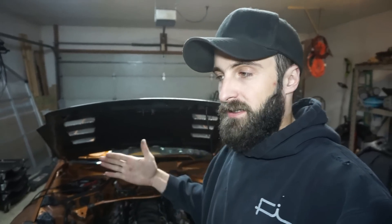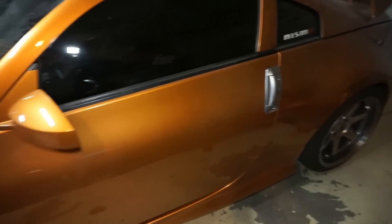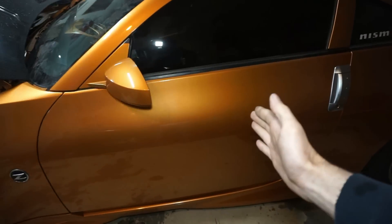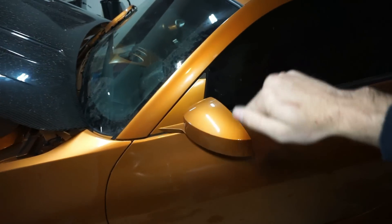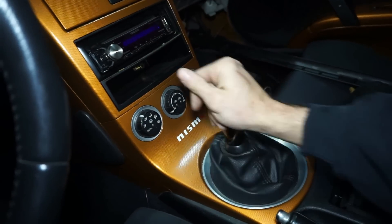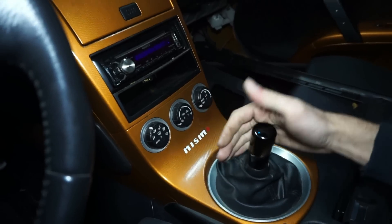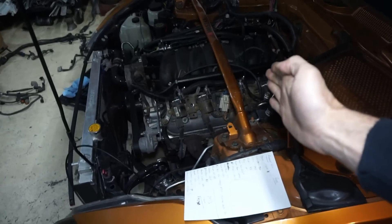The downside of using the Collins kit is the engine sits a bit farther forward compared to other kits, meaning you'd normally need a new driveshaft, modified transmission mount, and modified shift point. This car right now has the factory driveshaft, factory transmission shift point, and factory shifter — basically nothing was modified to make it all work as it should.